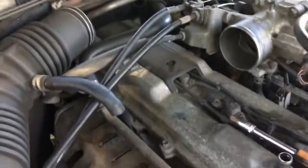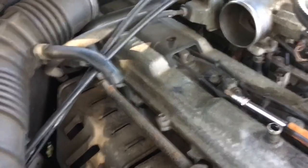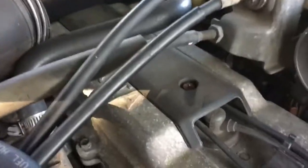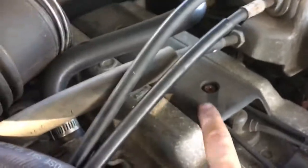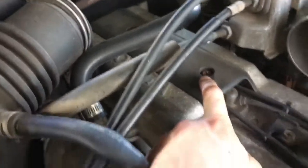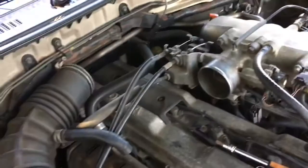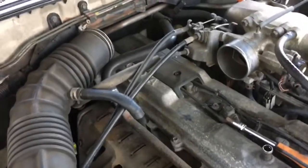So I'll put the camera down again and I'll get them undone with a small ratchet and my Phillips head piece. Remember, if you end up rounding the top of one of these screws, you put a little rubber band on top of the screw. It sometimes can give you a lot more friction, or prevents more damage to the screw. So I might have to do that. We'll see how we go.